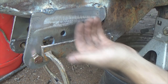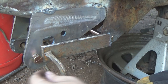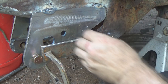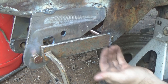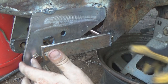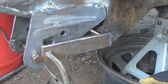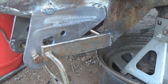The plane of this way offsets out from this way. So using this flat stock — this center line here welded into here — establishes the flat stock. When I run across here, the offset of this surface sitting on top of the bolt gives me my plane this way, the depth to establish that, plus I can weld in right here which locks in my two center lines. On my X, Y, and Z planes, that gives me everything I need to establish center line to center line. So I'm gonna go grab my welder now, weld those bolts to that flat stock, and I will have made my jig.